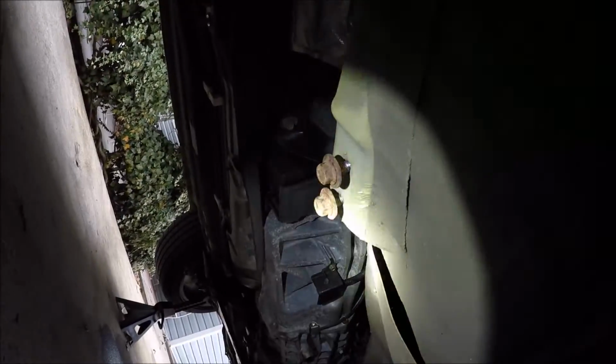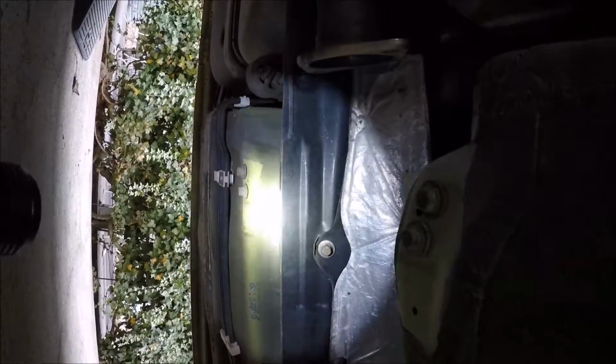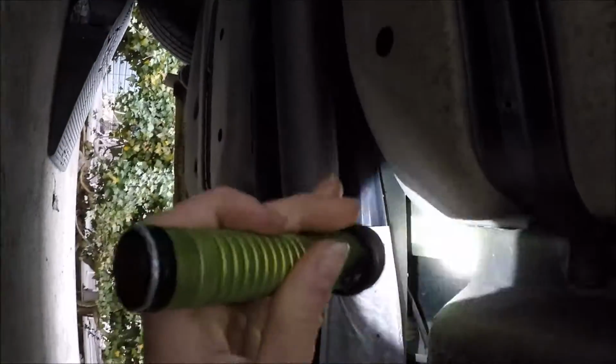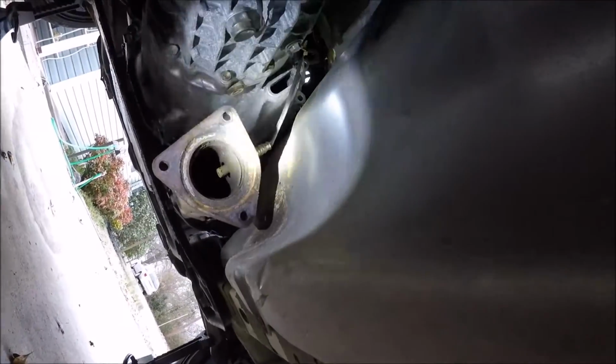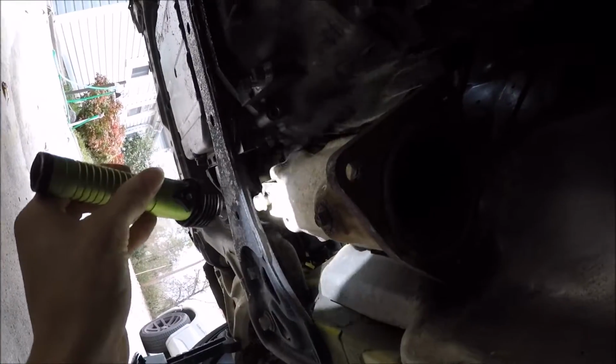Alright, so I said you had a plate there to there. You can take these bolts out, loosen those, it slides off. Same thing right here to there. Then you had the 2 bolts here on that pipe. You have the 3 bolts there, and you have to pry out a little bit on that one and push, but it came right out. Then you had to do that to get to the transmission. Oh yeah, you had a bracket here and to there, but you didn't have to take that off yet, but I went ahead and did it, just because it made it easier to get to that bolt.